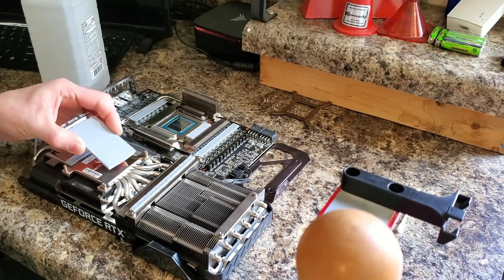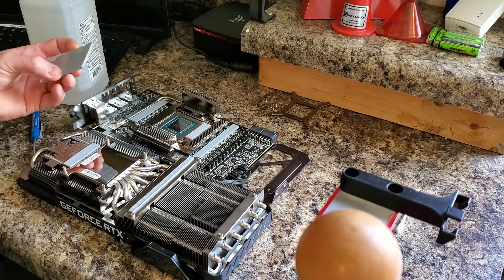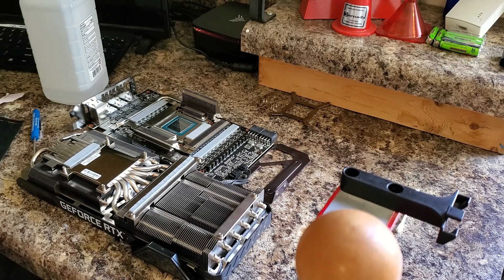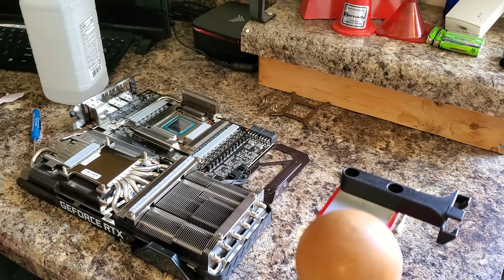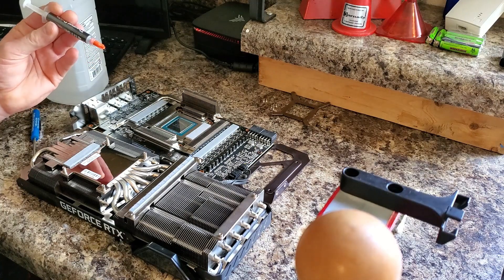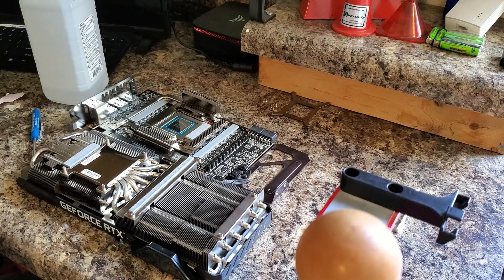To save a little material, I went ahead and cut a chunk off right off the pad — it's the exact width of the heat pipes, and this stuff is crazy malleable, it's like dough. I've got to get some thermal paste on there, and my paste of choice is this SYY stuff. It's every bit as thermally conductive — 15.7 W/mK — so it's right up there with the Cryonauts and things like that. But it's about half the price and it does not dry out as fast. I couldn't recommend it enough. SYY 157. Put a little thermal paste on and we'll get this slapped back together.